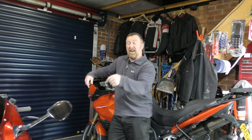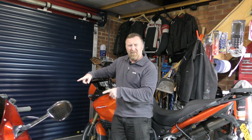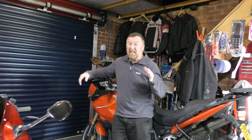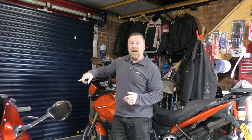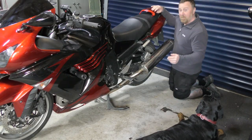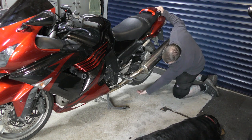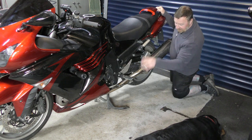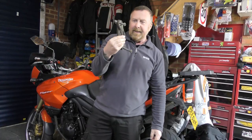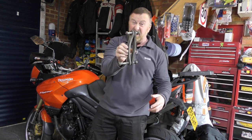I'll keep my Tiger while I'm doing this up — this is going to be my running bike. I like the Tiger being a short arse. This is lowered by the way — I don't love that it doesn't need to be lowered. I'm five-seven and getting shorter every year it feels like. Neither the MOT inspector nor anyone else can get this on the centre stand. There's a huge gap there that shouldn't be like that. I'm going to change these lowering links and put the original ones back on — they're really simple, unlike on the Trophy where everything had to come off.